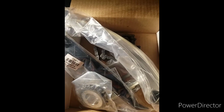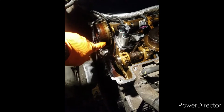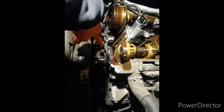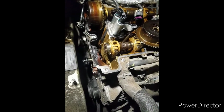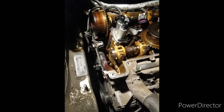It's all lined up. So I'm going to put on the tensioner. Goes on this side first. The guide, I'm going to drop that down in there because it comes up out of this way here. So I'm going to drop that down, get that bolt in back there, and then proceed on to getting this chain on that gear and this gear. Put that on with the chain hanging down through there, and then I'll move over to get this guide that's over here on. And then everything else. And then I put this piece here on last on the top. Here it goes up here. So yep.